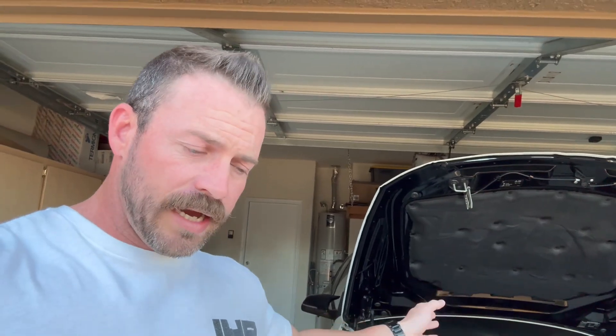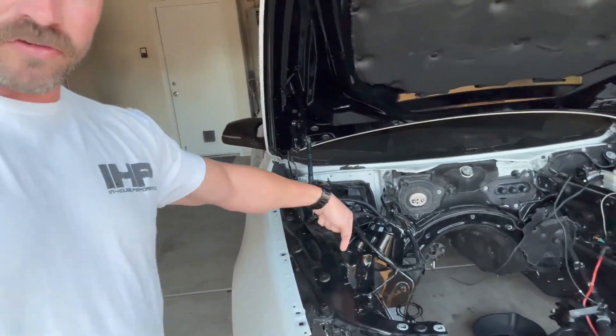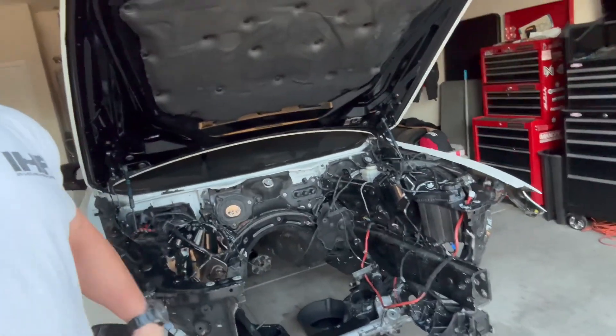I'm not going to be fighting the rear-wheel-drive thing anymore. If we're going to be making north of 1,200 horsepower, I'm going to need to put that to the ground. In keeping the big body, I'm able to run a bigger tire up front and a larger tire in the rear than I would on a two- or three-series chassis. Another thing I like about the bigger chassis is the wheelbase — it's going to help keep the car stable at higher speeds and higher accelerations. We're going to lighten it up seriously — take the sunroof out, cut the roof off, put a carbon roof on it, maybe take all the glass out, remove all the interior, cut most of the frame out. In this section in front of the shock tower, we're cutting the whole section out and removing the whole front end — this area is just going to be a single tube with a quick disconnect. So we're going to make some significant changes.